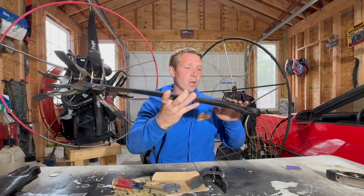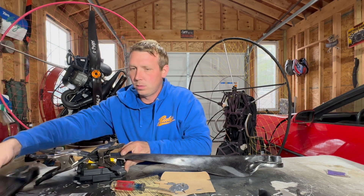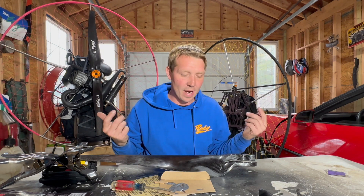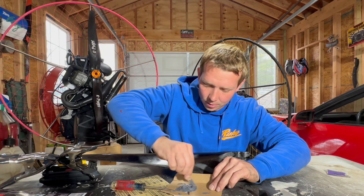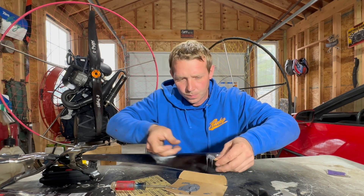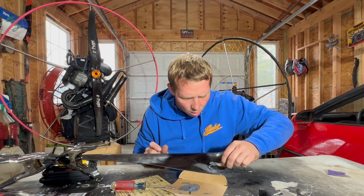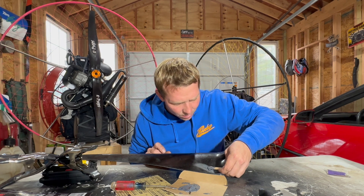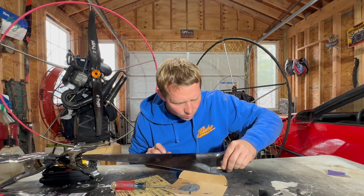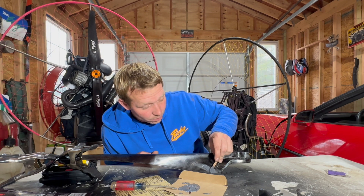Bear with me here in my shop, it's a rainy day and we have the Model A out there in the rain. Now what we've got to do is get this mixed up again. I like to hit it again while it's getting there, and all I'm going to do is get this on right where that crack was — boom. That's where the crack was, and now all I'm going to do is smooth this out right up to there, and then I'm going to sand a lot of this away of course, down until it's balanced.